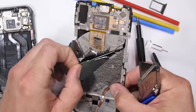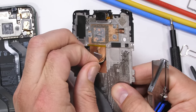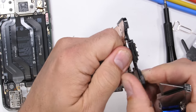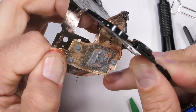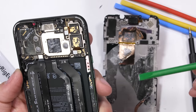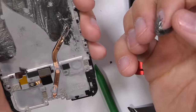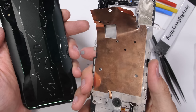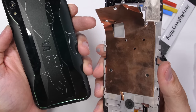I'll peel back the covering over the copper so we can see more of the thermal dissipation system. There's a ton of metal in here. The Black Shark 2 probably has just as much copper as the Razer Phone 2, just not all combined into one waterbed style heat pipe. There are multiple layers to the cooler. The main bulk of it is a thick copper pad that's directly above the processor. There is a smaller normal heat pipe like something we've seen inside of the Galaxy phones, down over the lower circuit board and charging port with its own thermal paste, also connected to that same larger phone-size piece of thin copper on top. It's a pretty ingenious design, especially for the price.